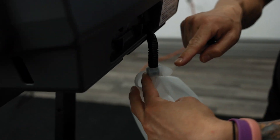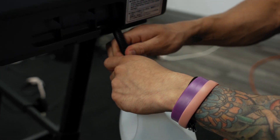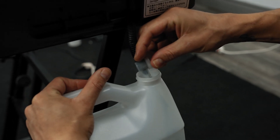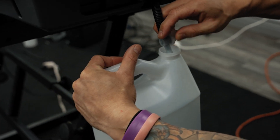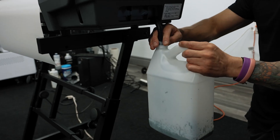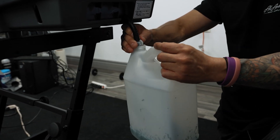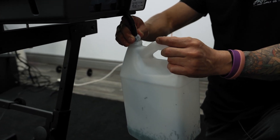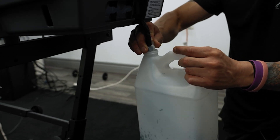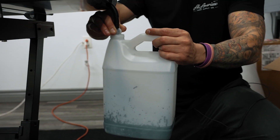If you're looking at your waste tube, this positioning is going to be the locked or closed position. Using our empty gallon bottle, we're going to safely and securely place this inside. Now we're going to turn that lever to the vertical position to open it. We'll give this just a moment — our waste ink is beginning to fill our bottle. Make sure you've got your knob turned all the way vertical for even flow. Depending on your print shop or workload schedule, your waste bottle may fill at different times, but it will always alert you to the current status on your MSM.